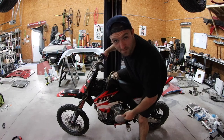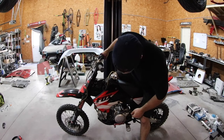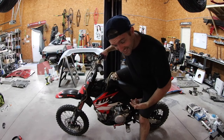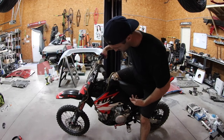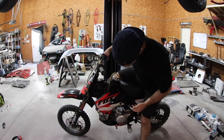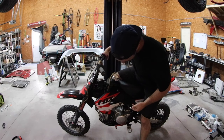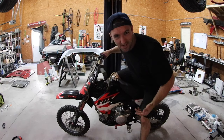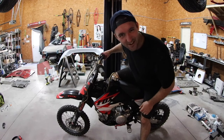So it's cold for sure, and I got the choke partially on. You can hear a little bit of an exhaust leak too. But as soon as I go to rev it, you can hear it fall on its face. If you give it part throttle, it'll rev up a little bit. So it does run, but not great. So we're gonna pull the bowl off and see if I can figure it out.